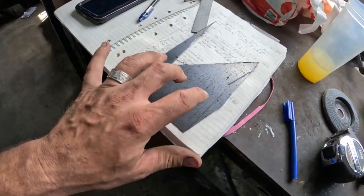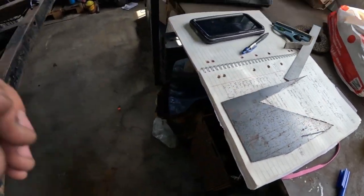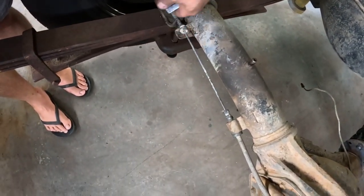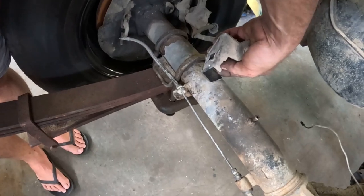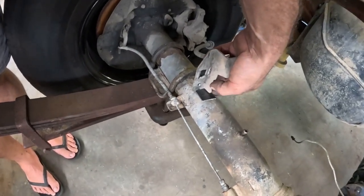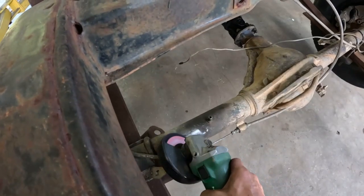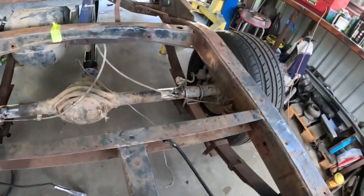I just found some scrap and marked out two bits of rectangle to cut out for those brake line brackets. I'm going to go ahead, get them cut, get them folded. I went ahead and cut these bits of plate out, folded them up, and drilled the holes. They'll land like that - I'll pick that hole up and weld them to the diff, utilizing the factory flexi lines. They can be changed at a later date if needed. I'll get the cleaning disc on the grinder, bare metal the tubes on the diff housing both sides, and get these TIG welds on.